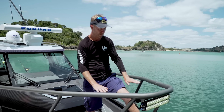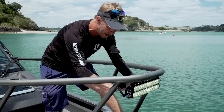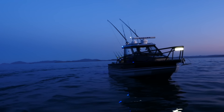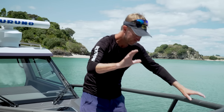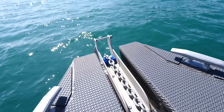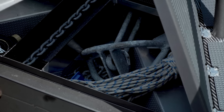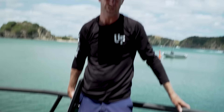Starting right up at the front with the HALA XLB spotlights — long range spotlights. I've got one beam shooting straight forward for distance vision, and one angled down to illuminate the water in front of me. Most people rig spotlights up on the roof, but as that light shines forward it illuminates the bow rail, the foredeck, and ruins your night vision. So I've had them built as far forward as possible, with a guard at the back to block light pollution, angled so they don't illuminate the anchor. No wrecking night vision, no light pollution, but maximum punch forward — achieved by stacking two HALA lights.